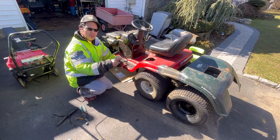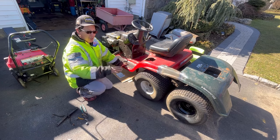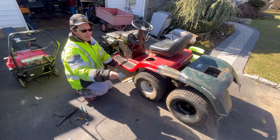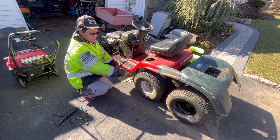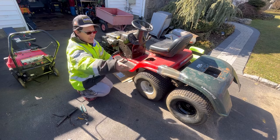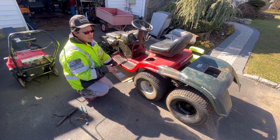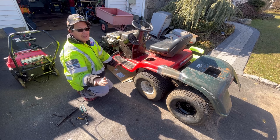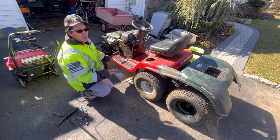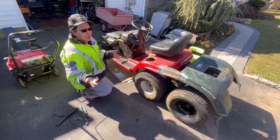And the reason why this tractor, I found out, kind of slips and doesn't really grip very well to move. As you see, when I get out of the garage, I've got this hump right at the door of the garage, and that's to keep water out of the garage. But to get over that hump, once that first set of wheels touch it, the driving wheels are spinning. That's why I have to give it a push to grip onto that bump so I can get traction and go. And then I realized down there that the belt is actually a little loose, so I could see a little bit of slippage. It's on the bottom pulley, so there's no idler or tensioner pulley that I could get on there to make it tighter. The only way I could get it to be really tight is if I got a bigger pulley. The John Deere ones have a bigger bottom pulley, so that will probably make a difference.